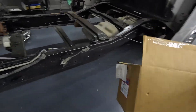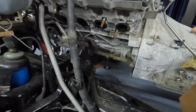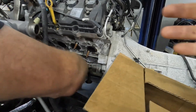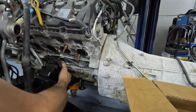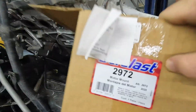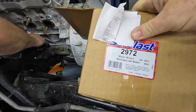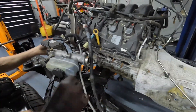Real quick, there are a couple of things we didn't go over. The 5.4s have a really weird motor mount — it's for the oil cooler, it's got a big piece right here. So this driver's side motor mount pushes things out and eliminates that issue. There's the part number right there — that's a Dorman part. You will need that motor mount to make this work.